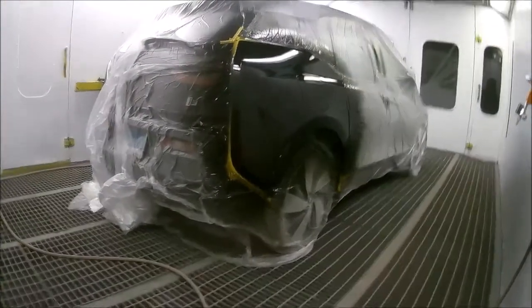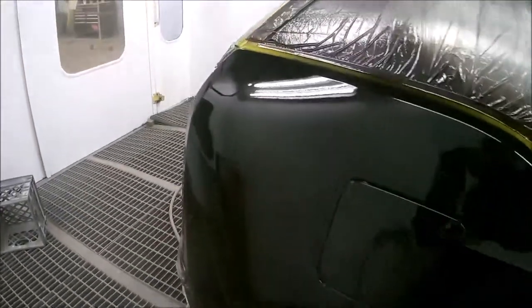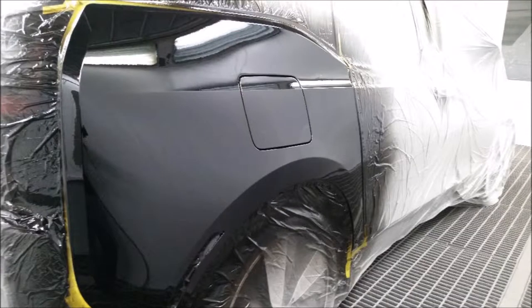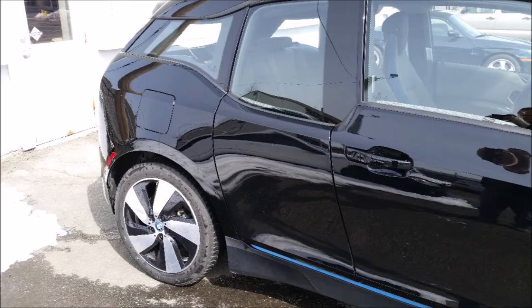The second coat of clear is wrapped up. Between the first and second coat it sat for about 10 to 15 minutes. I'm using the DeVilbiss Tekna clear coat gun for the clear and the Tekna Pro Lite for the base. For the clear coat it's at 1.3 with the TE25 air cap — spray is beautiful, I love it. I'm going to show a couple photos here of the finished product. It came out really well, the customer loved it, everybody's happy. It feels good to do a nice job and have the work come out nice. Thanks for watching.